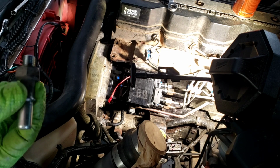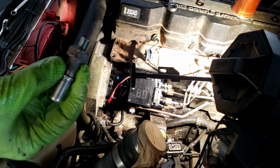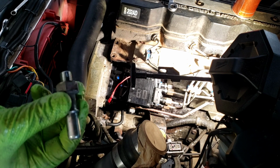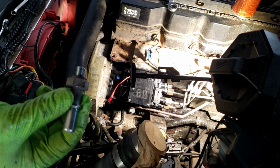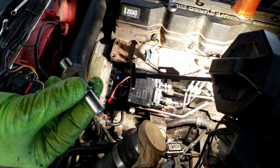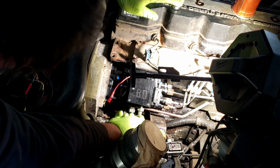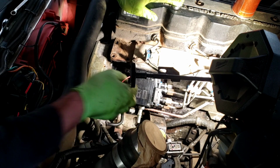I'm sure back then it was probably just to get the fuel pressure sender put in the line. And now I've got a different way of doing it. I got an adapter to do that with. So we're going to put this straight into the VP44 this time, which should give me a 1/2 inch of fuel line from the tank all the way up. And I've made some new fuel lines for these as well.